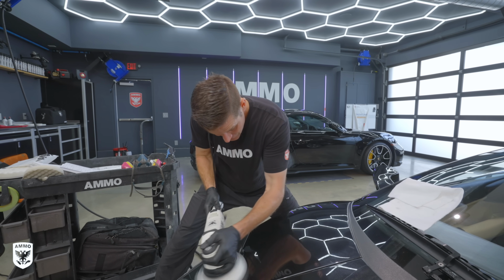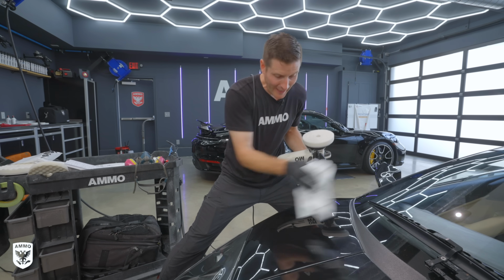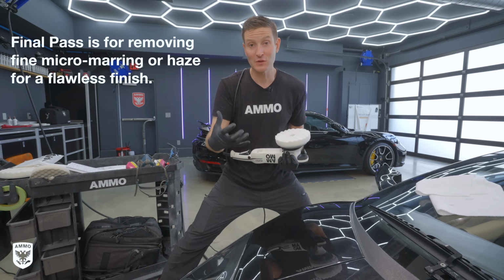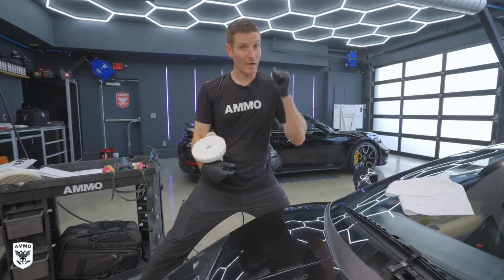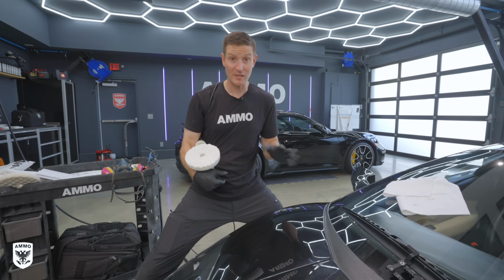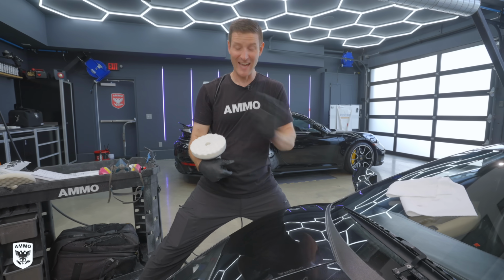And then I take it off. That's what we call a final polish. And the reason we do that is we're just cleaning up any last little bits of polish that was on there with the pad, and you're just smoothing it out. So that's the last little technique or trick that I like to use, especially for newcomers to polishing. We got to prime the pad, then do our test spot, and then when we're done, we figure out, okay, that's as many passes as I need to do to make it look as good as I want it to make it look. Then we do one final pass without adding any more fluid to it, and it's going to look fantastic when you're done.